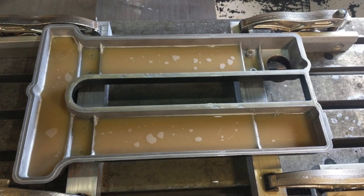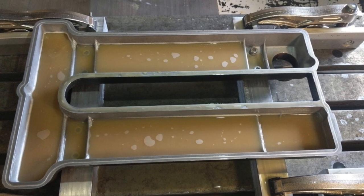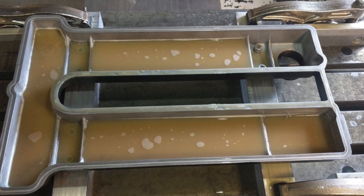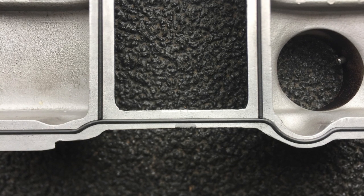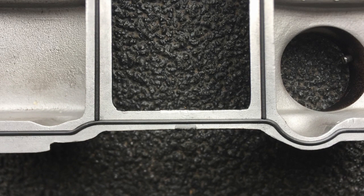Here's what the finished job should look like. This is a square groove machined two millimeters wide and 1.4 millimeters deep. Next, obtain some 1.78 millimeter section Viton O-ring and push it dry into the groove all around the engine cover.